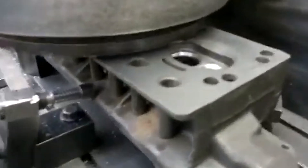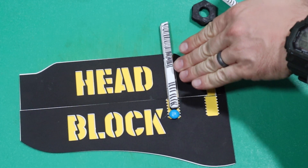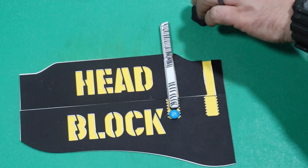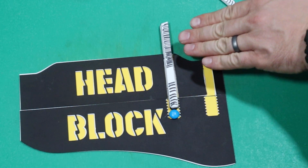Also, heads that have been skimmed are even more prone to this problem as they now have a shorter overall bolt path to begin with. While it isn't ideal, if you were to accidentally miss some debris and a stud didn't seat fully, you'd still have a better chance of getting a full clamp as the threads on the top side of the stud extend well below the top of a fully secured head, giving them more room for error.